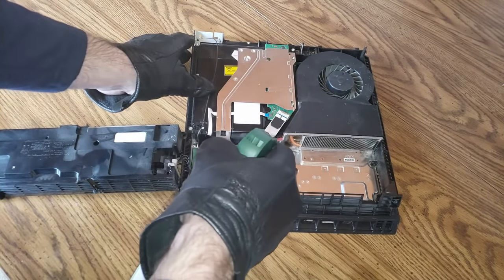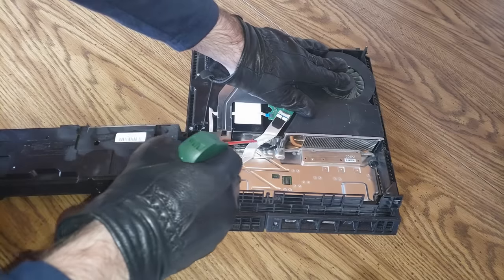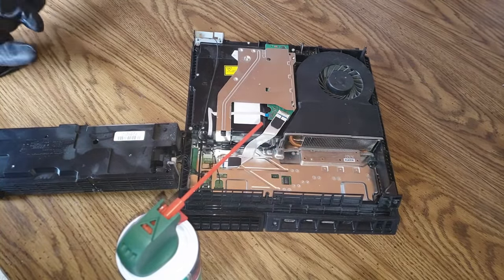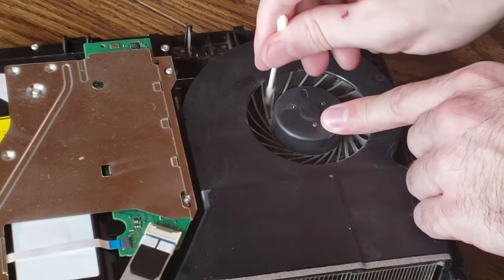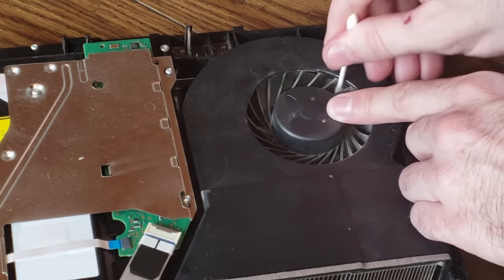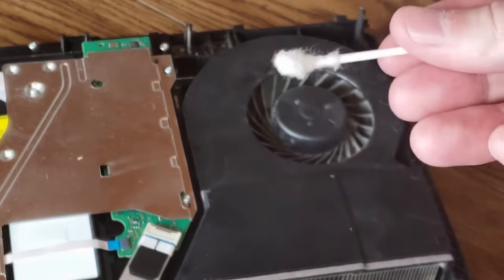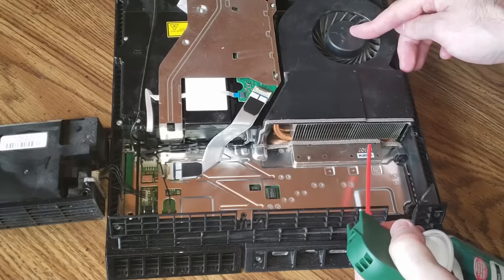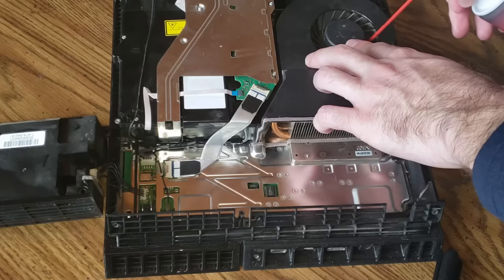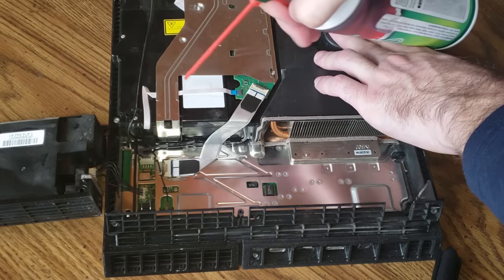Now start spraying where the power supply unit was — this area should have a lot of dust formed around it. As you can see, spraying into the vents where the fan is. When you start spraying into the vents area, remember to hold down your fan so it doesn't rotate; we don't want to damage the fan's motor during this process. When spraying into these vents leading to the fan, do a very thorough job. Now if you have a Q-tip, go ahead and use it at this point. My fan doesn't look all that bad, but when I go through with a Q-tip I'm collecting dust — you'll notice they are actually larger clumps. So just go through each individual blade of the fan with the Q-tip and do a very thorough job. Although my fan looks pretty clean, as you can see there are some larger clumps on the Q-tip. I noticed there was more dust on the bottom so I sprayed through the vents again. In total I spent about 3 or 4 minutes just spraying down specific areas around my fan.